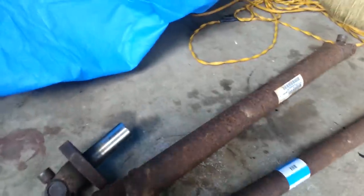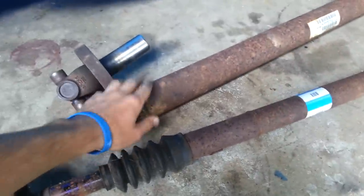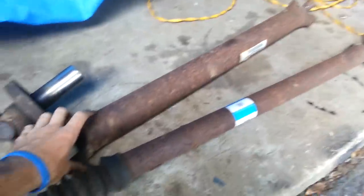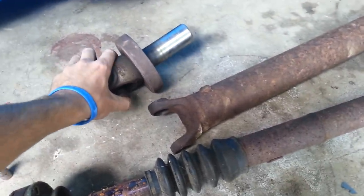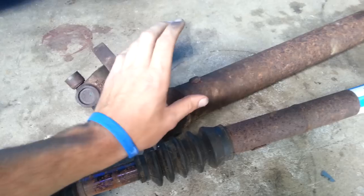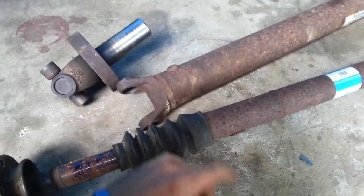Here's the drive shaft I was talking about. This is the rear drive shaft — this one came out of the donor Jeep. This is the inline six cylinder drive shaft. This slip yoke here is the V8 one. You actually have to take the slip yoke from the inline six cylinder shaft, take that off, and put that onto the V8 shaft.